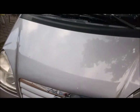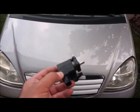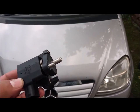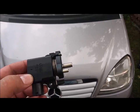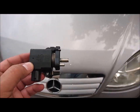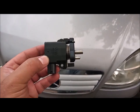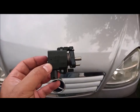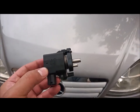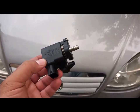Hi everyone, this is the Mercedes W168, W169, and W245 — it's all the same problem: code P0121. This is the throttle pedal sensor and all associated problems: loss of power, safe mode. You can see in my other video that I cleaned the throttle body itself to exclude buying this expensive piece. This piece is around $200, or you can find it on eBay for around $80 used. Other expensive brands with the same part number can reach $300–$400, which is very expensive for the value of this car.